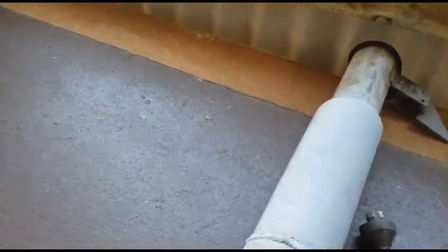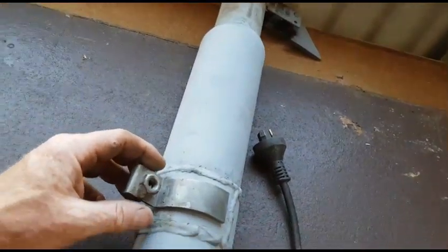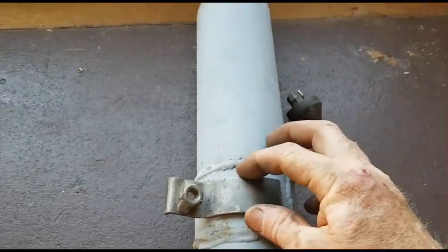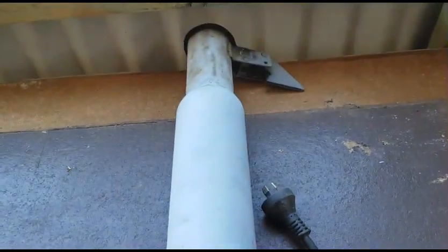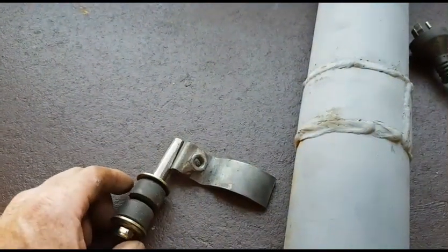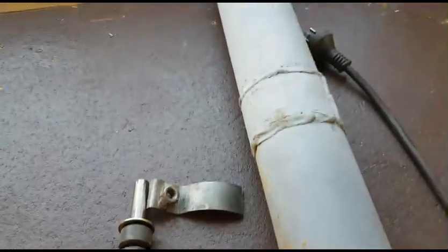So here's the muffler. I've gone ahead and made up this little bracket that'll go onto this reinforced area. We'll weld it down each side, top and bottom, and then this little piece is going to attach to the front, like that. We'll weld it both sides, front and back, and then the rubbers will bolt between that sheet metal where the exhaust came through.